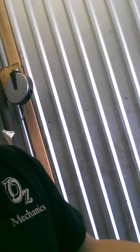I had to get a wiring diagram and trace what was connected to it. The thing is that this is a 93, so the wiring diagrams are hard, honest to God. It took me a while to try to figure out the cables. So I took this apart and was trying to see what cables go to what. When I was looking at the cables, I noticed that one of them went to, if I'm not mistaken, the ABS, and it was the ABS fuel pump shutdown switch and all that good stuff. So we had a bunch of cables intertwining to that one.